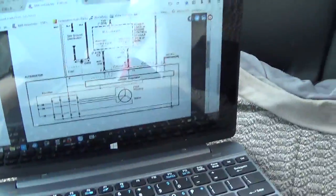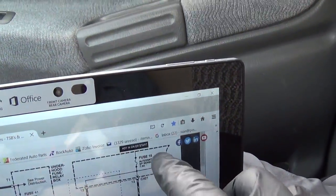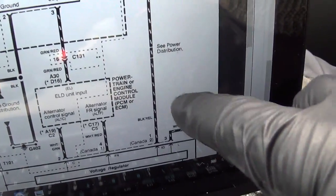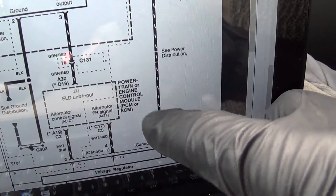We checked a possible known culprit but didn't see any problems. However, Keith took a look at it and sure enough he was right. This wire right here, coming from that 7.5 amp alternator fuse - the black and yellow wire - feeds our voltage regulator. Somewhere right here it was rubbing on that bracket that supports the intake manifold. The fix is just to leave that bracket off - he said it serves no purpose. We're gonna patch up that wire, take the bracket off, and call this one fixed.